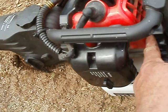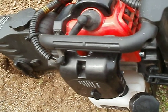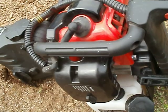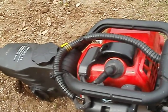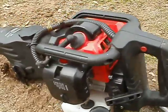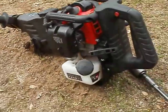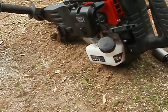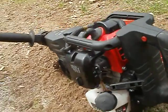and replace that with anaerobic gasket maker. And it did boost up. I could feel it in the pull. That it did boost up the compression pretty significantly on this, which is where you're going to get more torque, more power, and all that. And I don't think I did any other modifications on it. I didn't really want to.